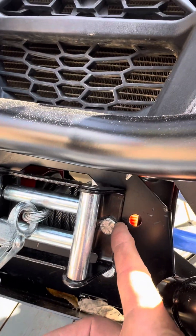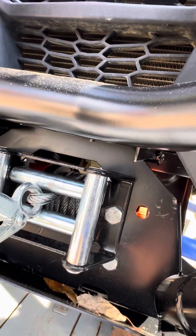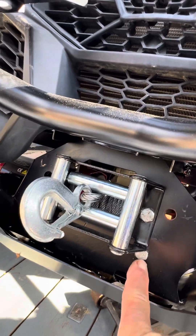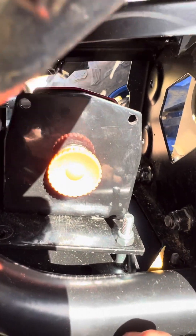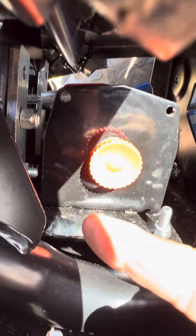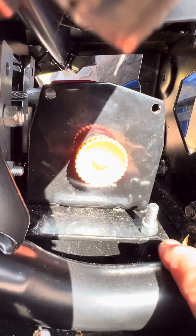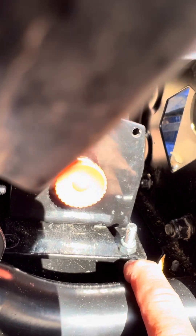These didn't require any drilling — there's a space cut out that worked. But I had to drill four holes and you have to get them aligned with this plate. I put the front in and tighten it up, and then I just went underneath and drilled holes that lined up with this, and then put these in.